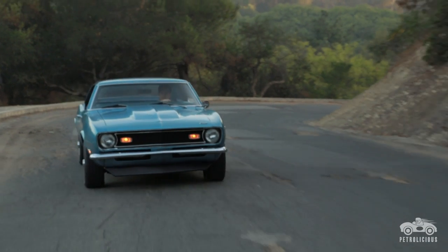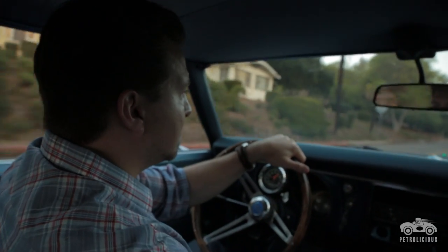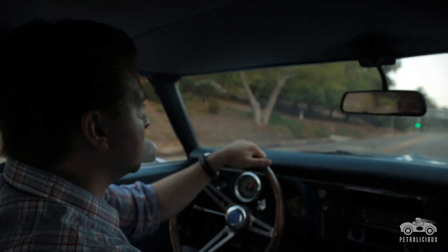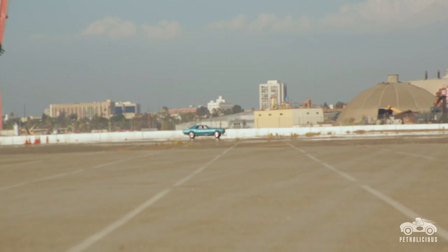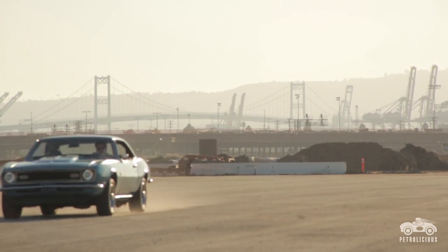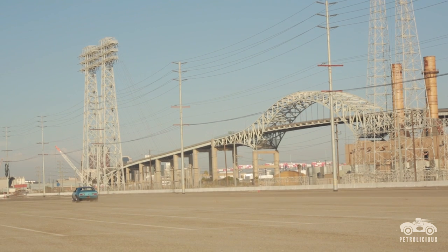Finally it was time to paint — this is in a wooden two-car garage. I've got the propane torpedo heater, we hung plastic, we had an exhaust fan. I started going over the car; the first coat wasn't very good, and spraying up top doesn't make sense — I should spray each panel as it would sit on the car. So I'm spraying along, paint's looking good, and stuff we were hanging from the rafters — well, I didn't secure them properly, and a coat hanger fell from the rafters right into my wet paint and left a perfect little coat hanger hook in my fresh paint. And, well, it's still there.